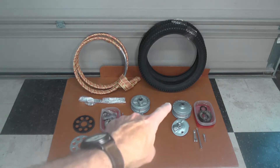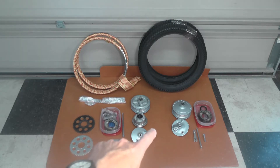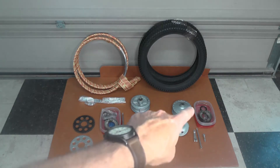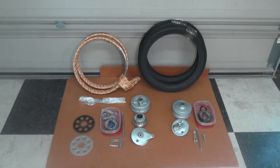The hub itself — I did install the bearings back in. Those are the original bearings that I cleaned and greased, all back together and ready to go. Those are the original brake shoes. I'm going to swap the front brake shoes with the rear brake shoes — they're the same shoe — because the rear shoes typically get more wear than the front. They both have plenty of meat on them. I did measure them, so there's no need to replace those brake shoes for this project.